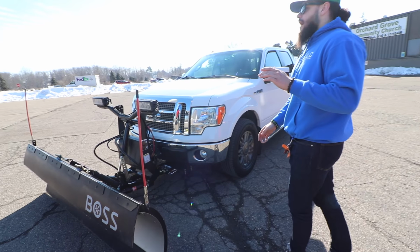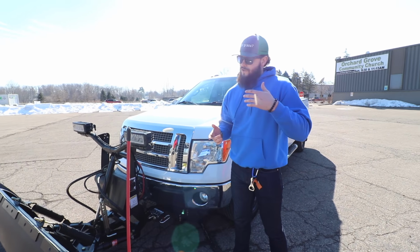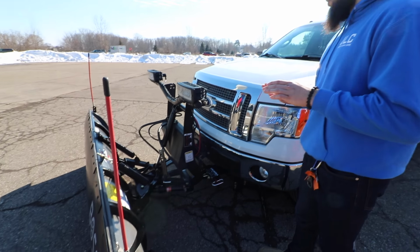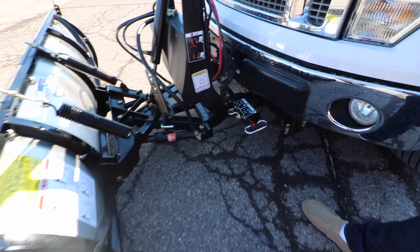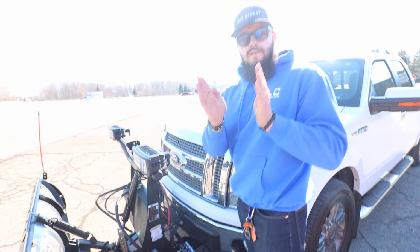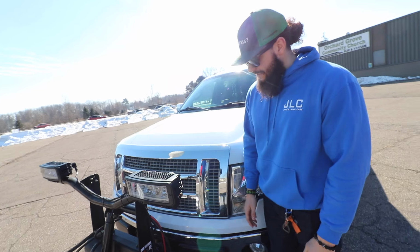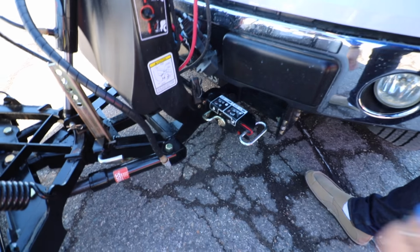On the first video we did, we didn't really go super in depth on hooking up the plow and everything like that. I saw some comments and thought maybe we should go a little more in depth. So basically I'll pull up to my warehouse, and the most important thing is you want to be straight in line with your plow, otherwise it's a headache. These aren't Westerns, boss. You get like 1 inch to line it up. Exactly, pretty much standard, just like you would do on the DXT.